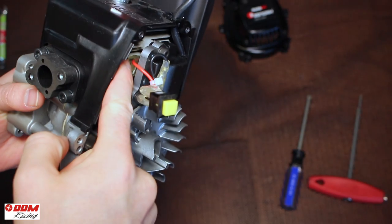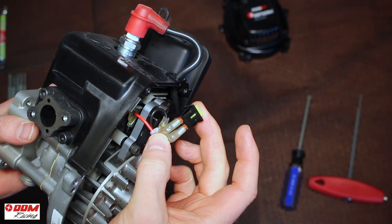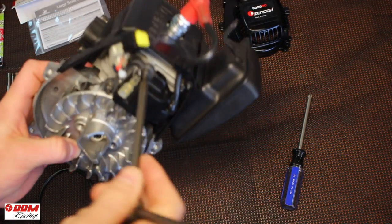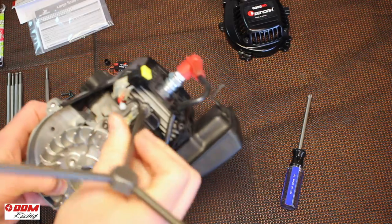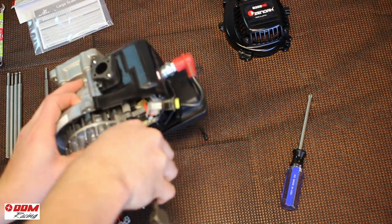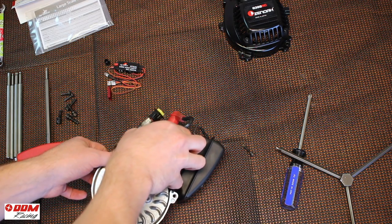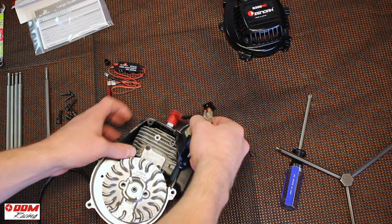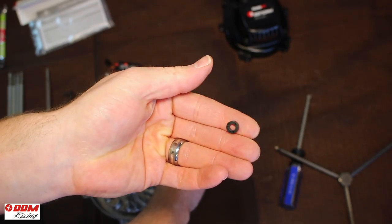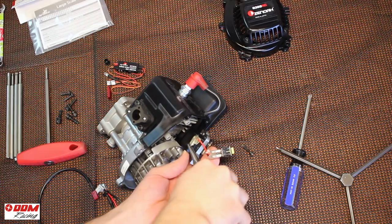You can see you've got a couple of spade connectors on the back and the front of the ignition coil, as well as on the back and front of the kill switch — the push button switch. You're going to remove the ignition coil. There's two screws holding it to the cylinder. Be careful as you remove it — there are two plastic spacers that go between the coil and the cylinder and you don't want to lose those. Set those aside somewhere safe, and work over a smooth surface so that if they do drop out you can find them.